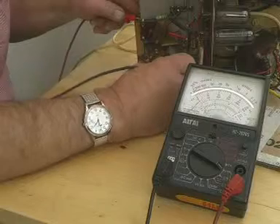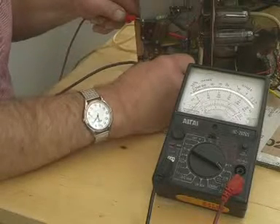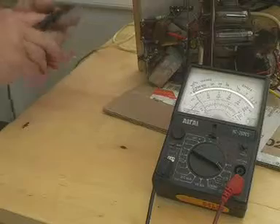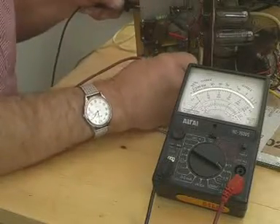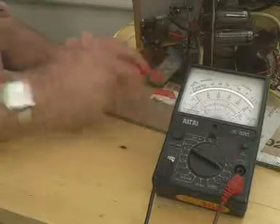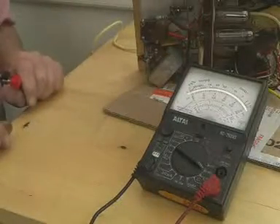It's indicating the capacitor is discharging. So if we do that, we'll charge it up a bit, then it will slowly decline — not very much — it's up around five or six thousand ohms, that's fine. Reverse polarity, there's a kick, and then it begins to go down again. So it looks as though these smoothing capacitors are not in too bad shape, so I think we could risk switching it on.